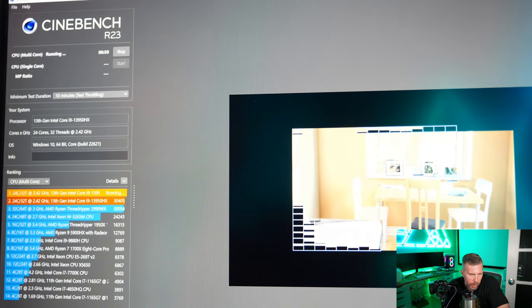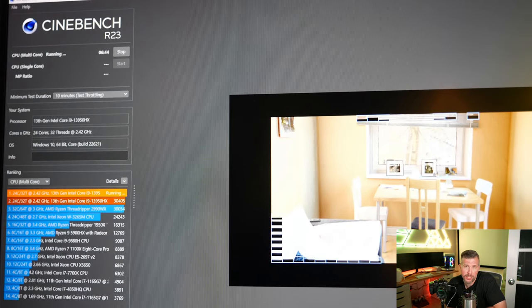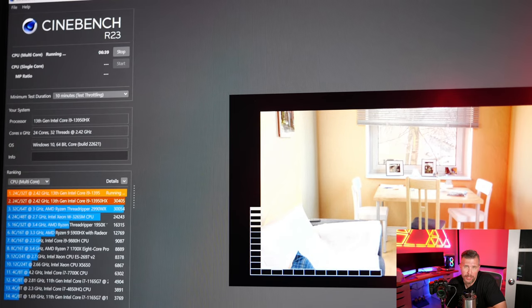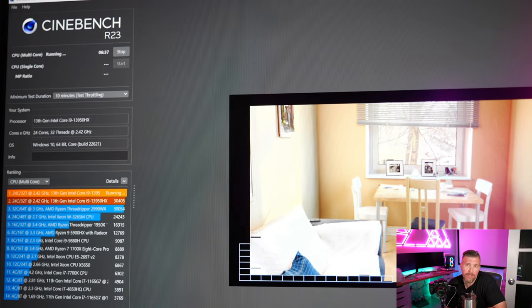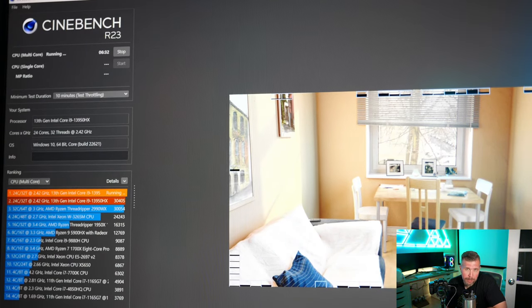If you keep it, will you upgrade the RAM? Like I said, no, I don't think so. Plus, if you go above 32 gigs of RAM, to 64 gigs, a lot of those kits don't maintain 5600 for the RAM speed. And I would rather have 5600 RAM if I can, because it should, in theory, boost esports games, CPU-bound game performance by a little bit, maybe 3 to 5%. The RAM speed is a factor for me when I'm picking a laptop this year. I do want 5600 RAM speed if I can get it.